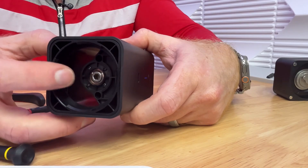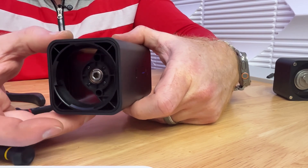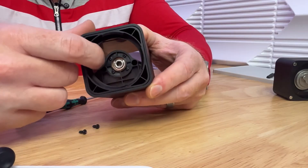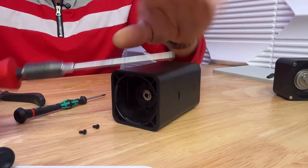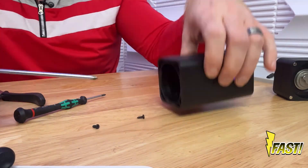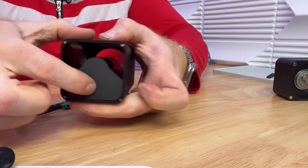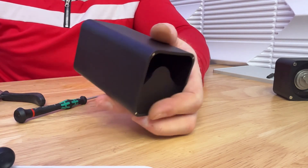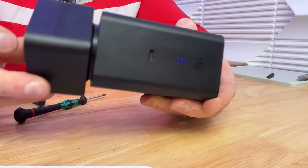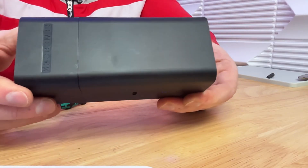Now you notice the RPM that's spinning out — it's only rotating at about 60 rotations a minute, so one per second, which is nice and slow for a conical grinder. So now we have our two screws for the cap — again, they have to go down these long channels, so you'll need the very long screwdriver. This is a PH1 if you are looking at what size you need. Once you have these good and snugged down, the lid on top should be very stable, which it is. So when you want to reassemble this, you'll take this and rotate it to a 45 degree angle. If it doesn't initially go in, what you'll need to do is just rotate — you set it into place where you know it's supposed to be, wiggle it a little bit, and it'll align the axle and snap into place.